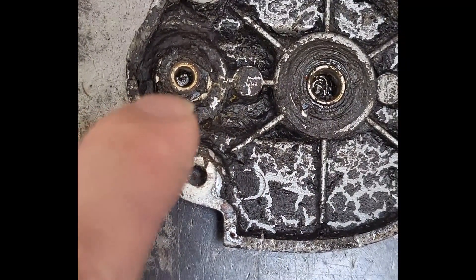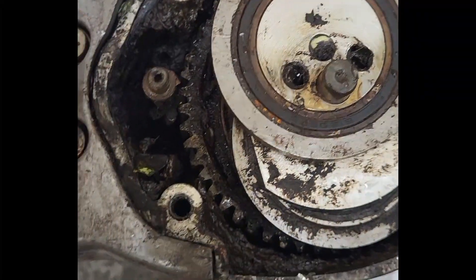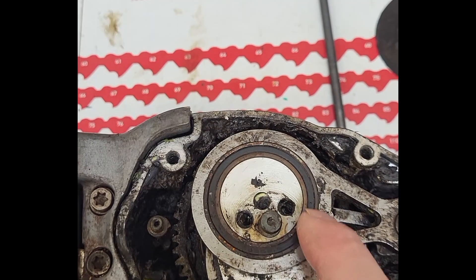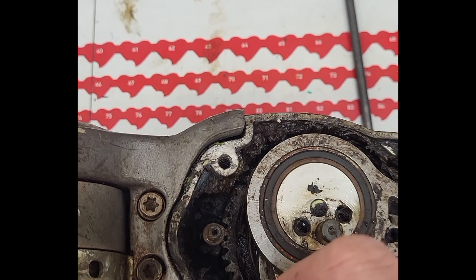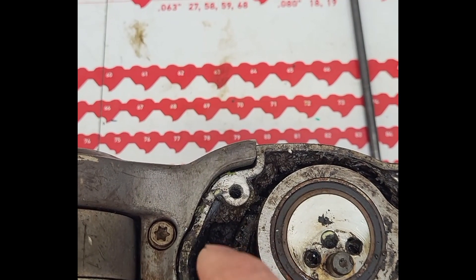The water gets all in the bearings. This one has an engine bearing on one side, and there's a sort of gear assembly bearing here. Two failure scenarios: one, the connecting rod — the top one will fail with crunchy bearings from rust and water entry; or the bearing where the engine shaft comes through will basically blow itself apart, all the balls will end up inside, and then it'll be metal on metal on the shaft.